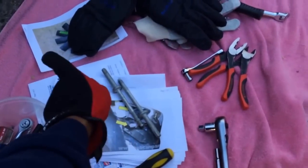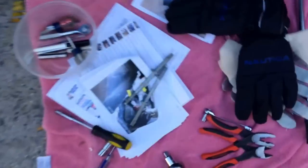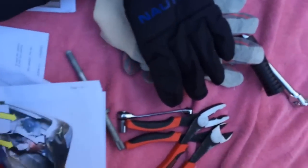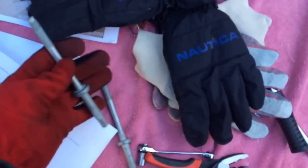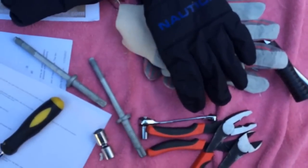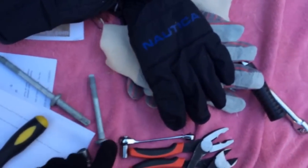On the pre-facelift sedan E46, you just take these two bolts out. You also want to remove the fog lights and the bumper trim that goes in the front under the fog lights. Once you get those out of the way, you can access this bolt right here. These are 9mm bolts, so you can just get a ratchet and remove those. You definitely need a clicking ratchet because it's going to be a lot of turning to get these out.